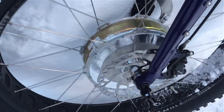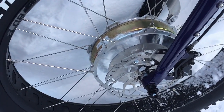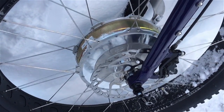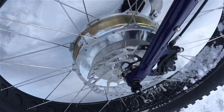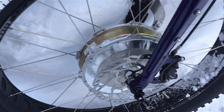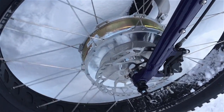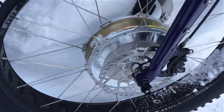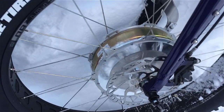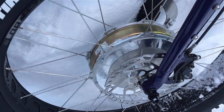This is a direct drive motor, which means it's very silent and you can use regenerative braking. The main downside of a direct drive motor compared to a geared drive like the EZ is that it has a little bit of what's called cogging torque, meaning when it's spinning it has a very faint resistance. So if you're planning on riding the bike a lot with just leg power alone, you might want to consider an internally geared motor.